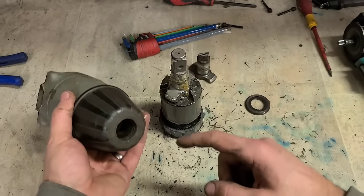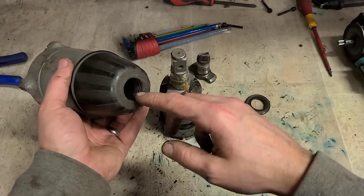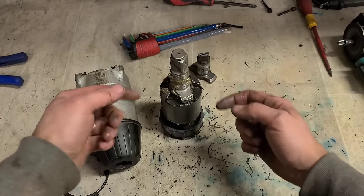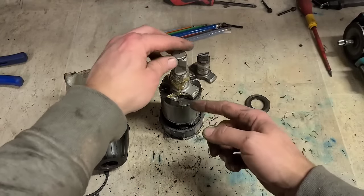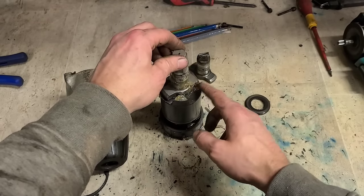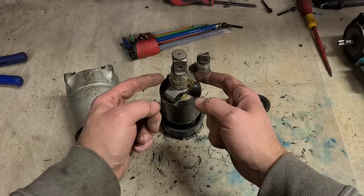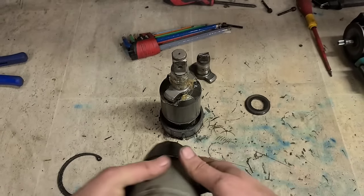So this one won't actually bind up like some of the other modern cordless machines. You'll hear them starting to growl and wear out the steel bush in the middle. That's because of no hole in the anvil. So they put it together, put a bit of grease on, whatever grease is there, whenever that wears away, that's it. These Makita ones, this Makita one especially, and some of the modern Makita cordless ones have a hole up the center, so any grease that gets in pushes out and self lubricates the steel bush. It's a much, much better system.